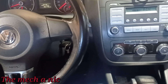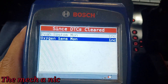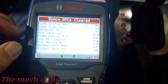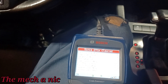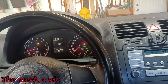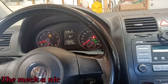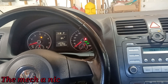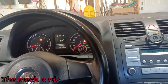I'm not going to keep running it all day - a car needs to be driven properly to go through its drive cycles. Going into drive cycle monitors, the only ones that haven't cleared are the EVAP system and the oxygen sensor. In order for those two to complete, the car has to go through various cycles of driving on the expressway, a certain number of cold starts, things of that nature - which I'm not going to do. I'm not going to waste the customer's gasoline. So I'm thinking of calling the owner and telling him to come pick it up and drive it around. If the check engine light comes back we'll look into it again. If it doesn't come back within a couple of days he could stop by so I can check if it's ready for emissions, or he could take it directly to a facility himself.